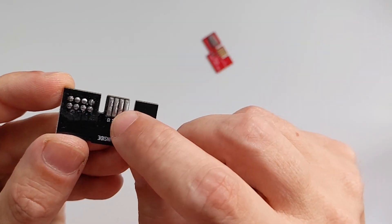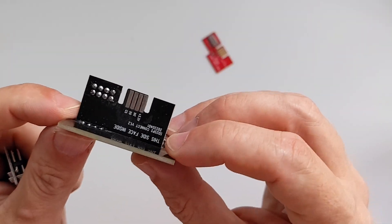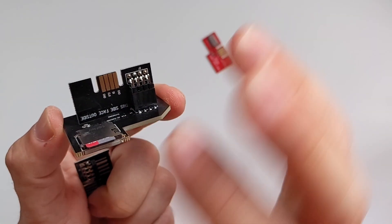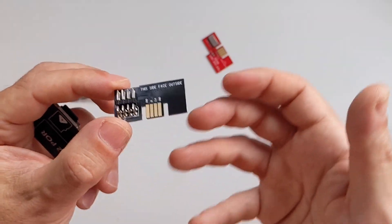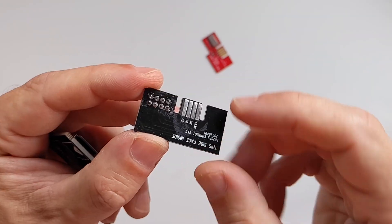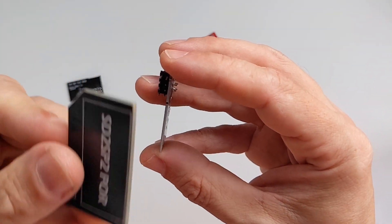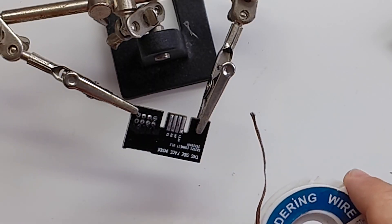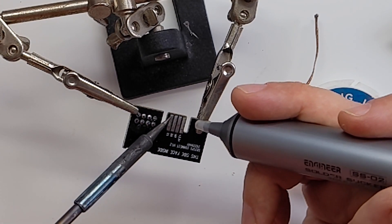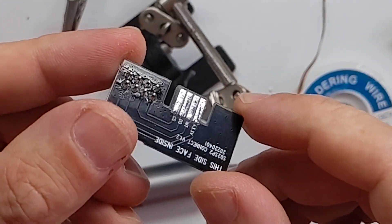Seeing as this was my second attempt, I tried solder on both sides to see how that goes — it didn't actually work; the fit ended up a little bit too stiff. So what I would recommend is just putting extra solder on one side and trying that first. If that works, leave well alone. You may need to try a few different configurations. What I've found works best is to leave this face outside as originally, this face inside, and add a thin layer of solder to each of those. Plug the first PCB into the console first, then attach the secondary PCB onto its pins so it fits flat and the pins have gone all the way in. If you end up with too much solder you can heat it up and use a solder sucker to remove the excess. You're really going for a thin layer — no lumps and bumps.